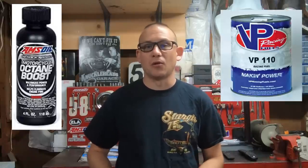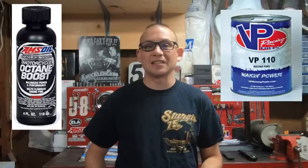For a street bike, it's really best to keep your compression at 10.5-to-1 or less. That way the bike is still going to run on premium octane fuel. Around here we've only basically got 91 octane widely available, but depending on what state you live in, you might have 92 or 93 available. Because if you get into an engine that has compression over 10.5-to-1, you're either going to have to use octane booster or mix it with a little race gas.